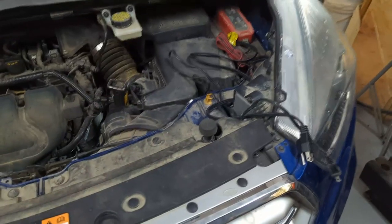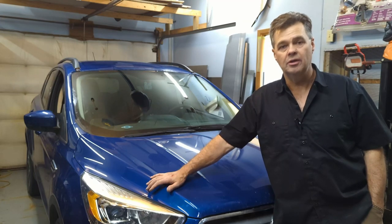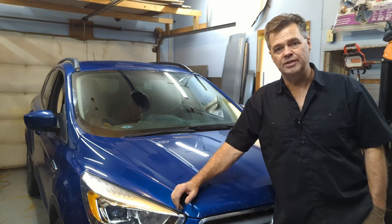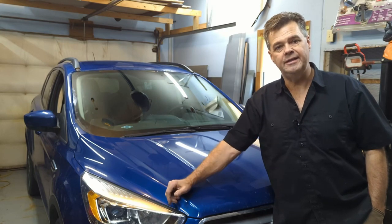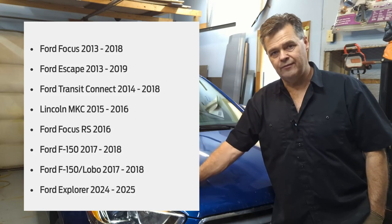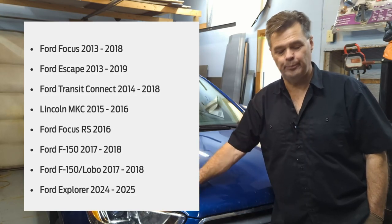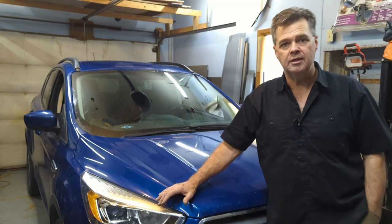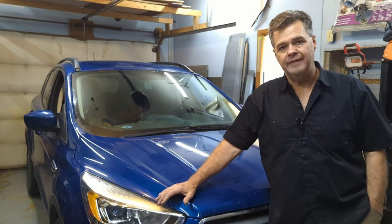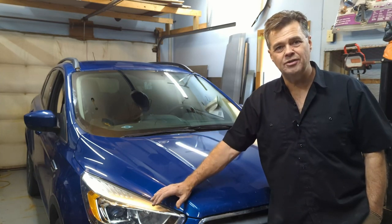Very simple — I think anyone can do it if you have a few tools. Save yourself some money instead of taking it into a mechanic shop or dealer. Just remember, don't do it while the engine's hot — just common sense. Don't burn yourself; let it cool down so it's tolerable. That's how you fix a leaky block heater in one of these Ford Escapes. The F-150s and F-350s in that range of years are probably all leaking too. It was taking probably an eighth of a gallon of antifreeze every couple of weeks, and they'd probably get worse anyway. Thanks for watching and we'll catch you in the next one.